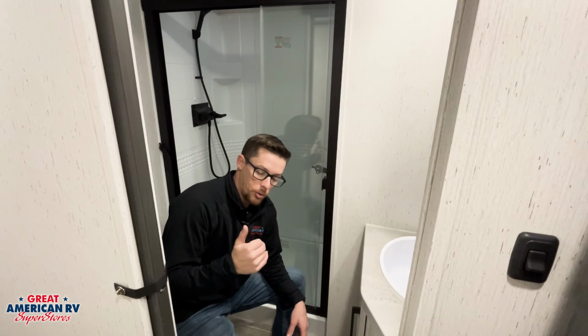For whatever reason, one of these outlets isn't working due to they got wet and it tripped that outlet. Or you put in too many griddles or heating components, too many coffee makers, whatever, it overrode that component and it tripped out that system. If those outlets aren't working, come here first and hit that reset button and see if your system comes back on. You may have to unplug some of the components that you have plugged in before you reset that system.